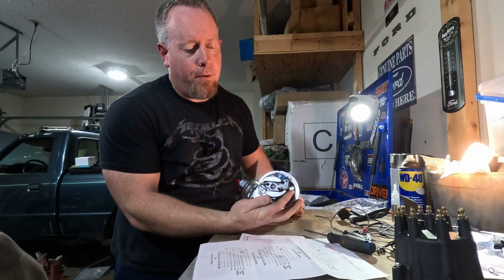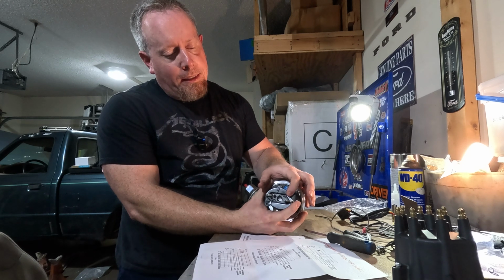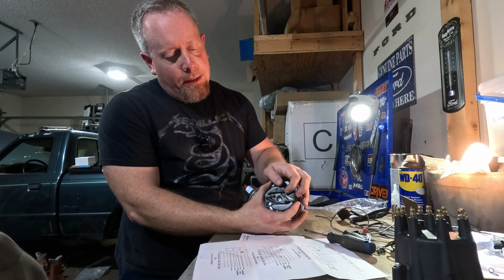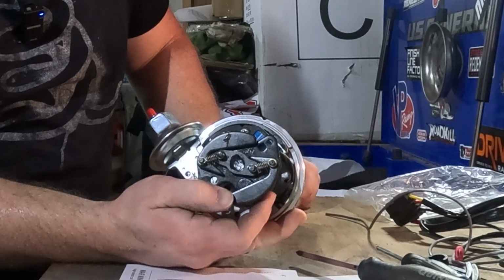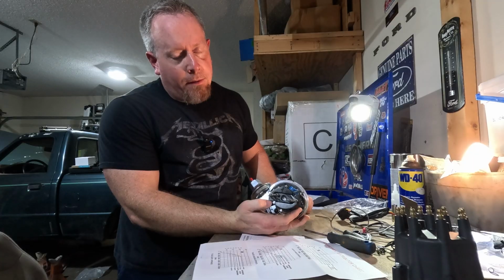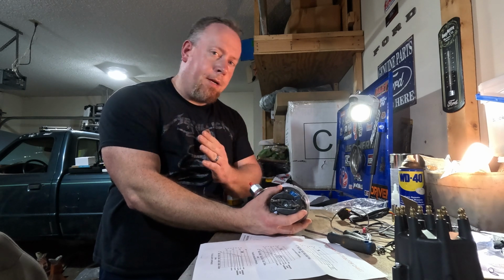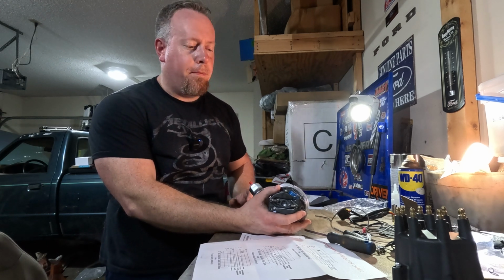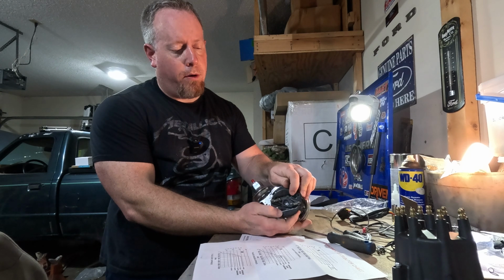In case you guys don't know, this is how mechanical advance works in a distributor. Centrifugal force occurs when the engine is spinning at enough RPM that the weights here have enough force to overcome the spring that's keeping it closed. As soon as that does have enough force, the whole shaft is not turning. I'm holding the shaft still, but you can see as the advance comes in, it's able to rotate the platform that the rotor bolts to, and that's causing the ignition to go to the spark plugs several degrees earlier than it otherwise would. So at base timing, it's going to be at, say, 14 degrees of base timing. And if we have this set to the maximum, it looks like the maximum is 18 or 19 degrees of mechanical advance. So when these fly open, they're going to rotate it to whatever the bushing allows for that.